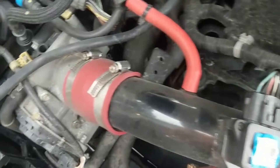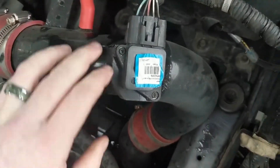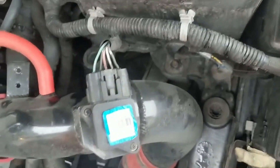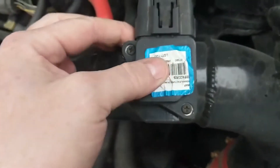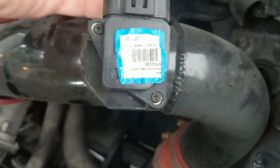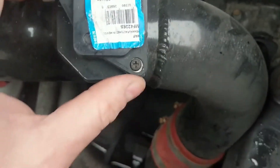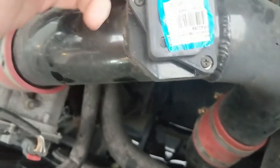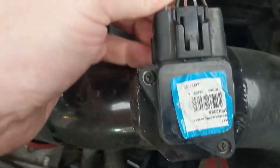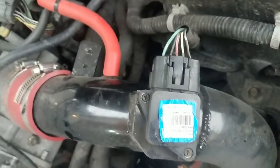So on the Mazda, this is your throttle plate and you've got your intake tube. This one has an aftermarket cold air intake ducted down in there — it's the cheap one off eBay. But right here is where your mass airflow sensor sits, and I bet this thing might be dirty. I've also read online that they sometimes need an aftermarket wire put in, or actually it's a factory recall.